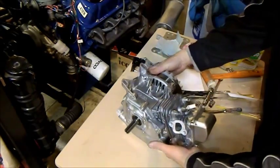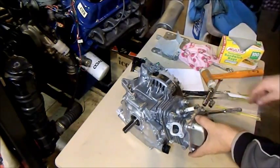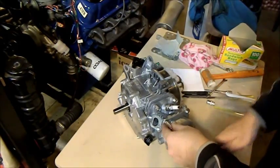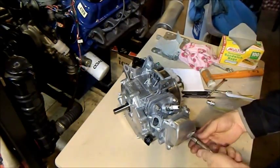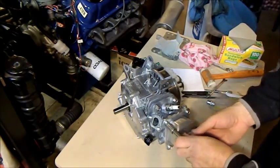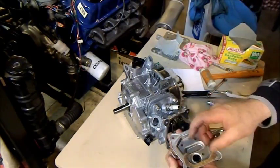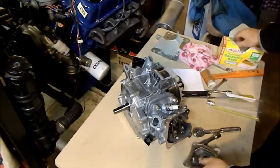There's the basic structure of the motor. Let's go a little bit deeper — let's take the top off. Again we're going diagonally, even if you don't have to — it is good practice to get into the habit, because you'll end up doing it subconsciously and it might even save you from ruining a part later. Again, bag and tag, and be very careful when you take it off — there's a very thin cork gasket. You want to stick that in the bag right away so we don't lose any of those parts.